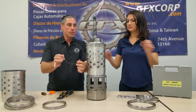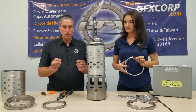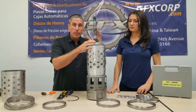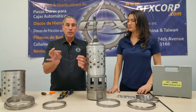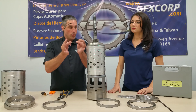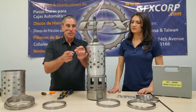It's a snap ring with a notch to protect the snap ring from spinning in the aluminum drum. Very important is that when you pry out the snap ring, you go 180 degrees across the slot side. So if you want to get the snap ring out with the steel ring or tool ring, you're going to pry on this side of the snap ring.